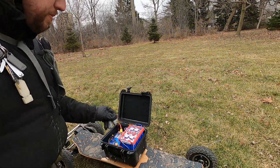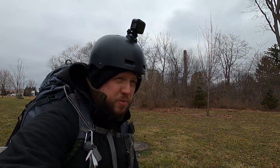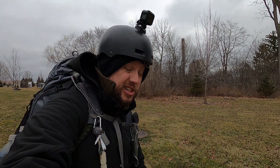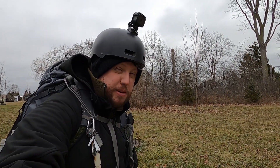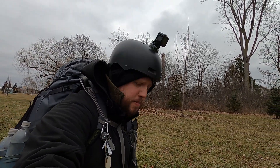If I did my math correctly, we're going to get about 15 kilometers of range off the sodium ion battery, but I'm a little worried because this thing has extreme voltage sag and I have yet to test it at the low end of the charge. It's probably going to get pretty severe, so I don't know if we're even going to get the full breadth of charge from this battery pack.